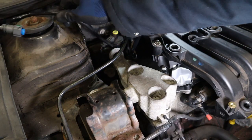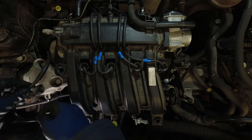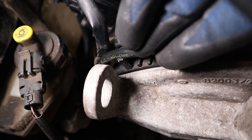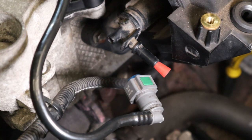Fuel supply pipe next. Grab it from the strut tower or wherever you put it. It goes under the fuel vapor pipe like that. And then you clip it onto the rocker cover into the bracket for it there. And then unlike removal, this just simply pushes back on.